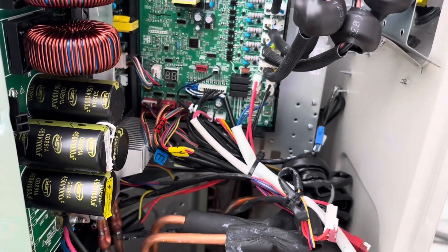Just cleaning up some wires now. Whenever you're doing a board replacement, make sure you figure out where each one of those plugs go. Sometimes it says it right on the board, but sometimes you've got to trace it out or look at the schematic. That way you know better where to diagnose something or test later on — either a different unit of the same model or that same unit later. You're not scratching your head wondering what wire goes to which component or which part of the board. Changing a board out is very, very good for learning the layout of a unit.